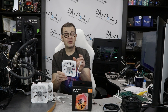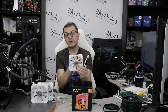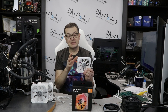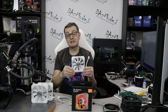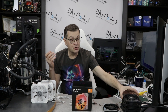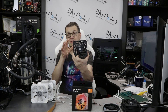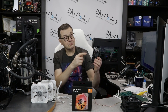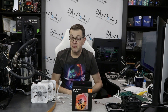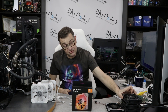Looking at the size and shape of the blades — they're kind of wide with a lot of gaps — so when the fan is trying to push air through a radiator there's a lot of space for air to escape. Those fans theoretically should produce less pressure than high-density fans such as Noctua or Gentle Typhoon, which have thinner, longer blades with smaller gaps between them, creating higher pressure. Even looking at the Apex, it has similar high-pressure characteristics — a turbine-type blade cut.